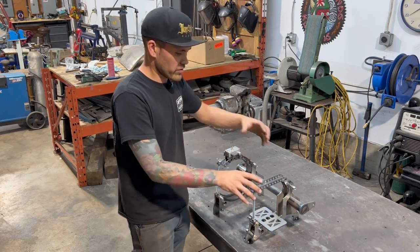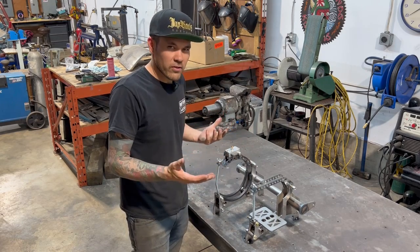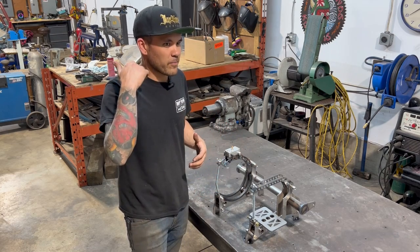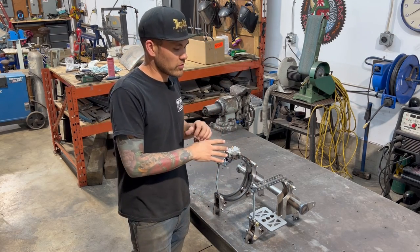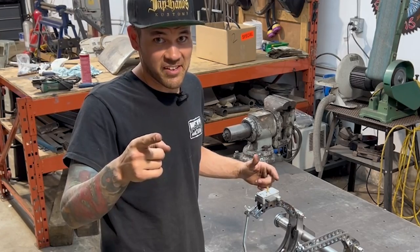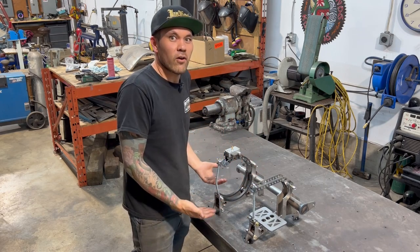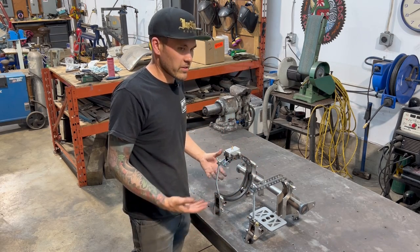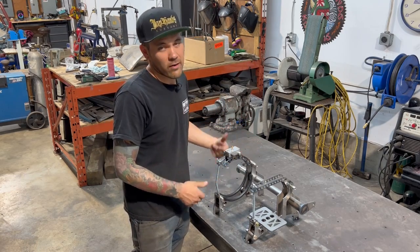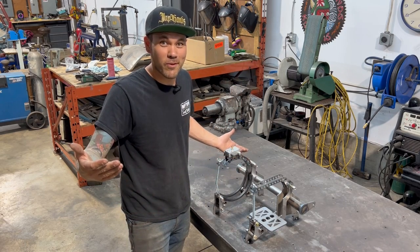We make the bottoms first, then we'll make the tops, right? There's simplified steps. And for a lot of you guys, you don't have a CNC plasma to cut all this stuff out, but I only had that machine for a couple of years. So before that, I would just do this all out of cardboard. It's another type of CAD, cardboard assisted design. If you built this all out of cardboard, you could know whether or not it's going to work for you and be able to change it easily with scissors and whatever, and then go to cutting it out of plate. That's how I love to fabricate stuff.